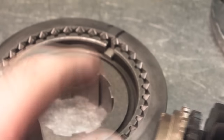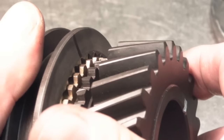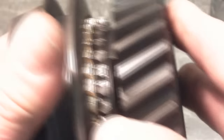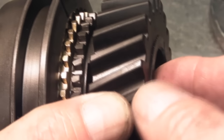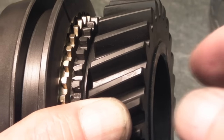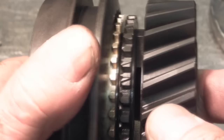Now that we know how this works, it will only allow the gear to stop and blip backwards slightly for the ring to come through it. Being that all these gears are in constant mesh in a transmission, the whole gear train literally has to get blipped slightly backwards. You have backlash in it, but considering the mass of the gear train, it has to blip exactly backwards — ever so slightly.